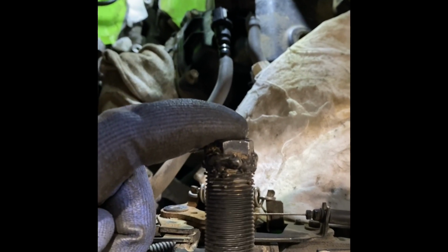And then yeah, once you've got that, then we'll put our slide hammer on. So here's a little adapter I made up. It's M20 by 1.5, and I welded an M12 nut on there. And again, you can really use anything you want, but I just found the M20 by 1.5 drills out all the plastic without taking too much off the body, which would not be good.